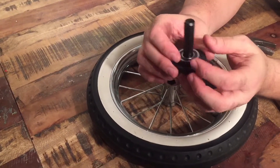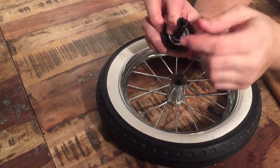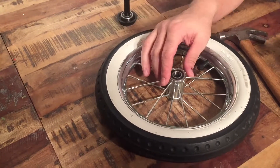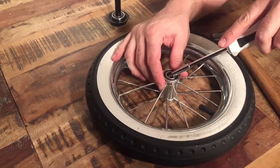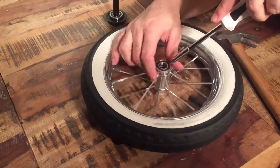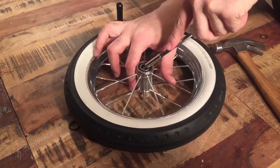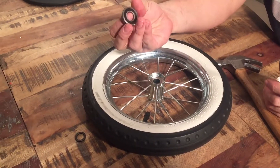If you think the plastic is too old and brittle, or there's too much rust inside, you're going to need to work at it a bit more so you don't bust these plastic lips — if this is a piece you're keeping. This did take the inner ball bearing with it, which is fine, but I'll show you how you go about removing these ball bearings in case that's what you need to replace. You just need a flat-headed screwdriver and you're going to get it under and work your way around — because it's sitting in a metal shaft it doesn't just pop right out, you do have to wiggle it out a little bit at a time around the circle. There you go — and there you have it, the ball bearing as well.